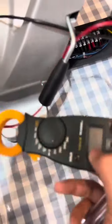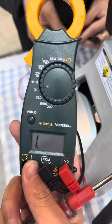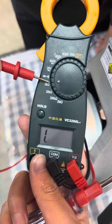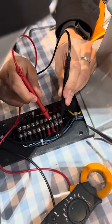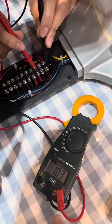Open it just like this and it will open. Then use the multimeter and change it to the resistance mode — the smallest resistance mode. Put one end here, and the other end to terminal number one and terminal number three. This is used to test the condition of the top platen.